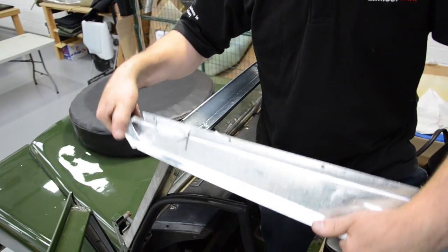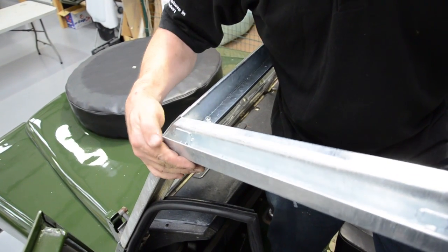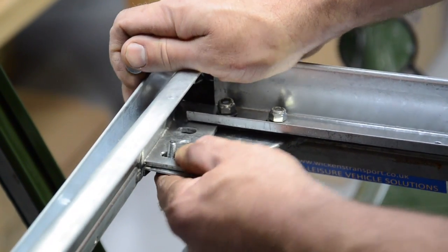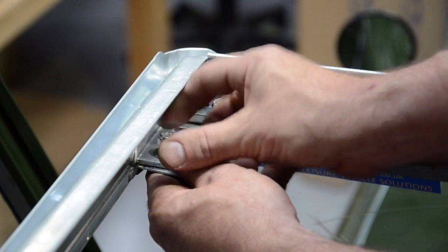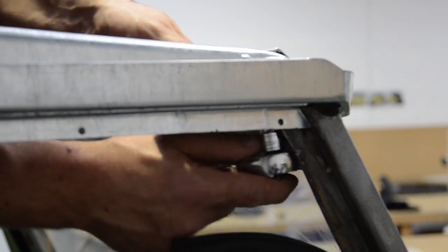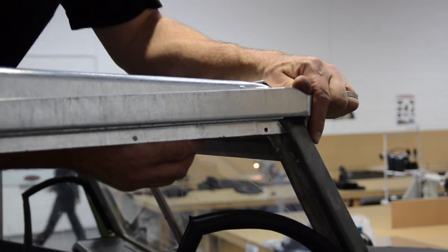Passenger over-door drain channel. The bracketry on the back sits on top of that bracket, and this shaped part here sits inside the front over-door, so it should slide in and under. The bolts and washers go up through from underneath, through the plate and into the over-door drain channel — done finger tight, much like the rear hoops, just to get them all aligned to start with. If you can't align your bolts in the ones over the over-doors, slacken off the screen header rail and see if that makes life easier with the plate underneath.